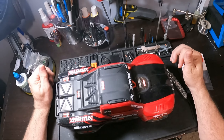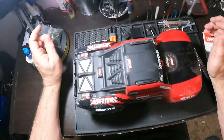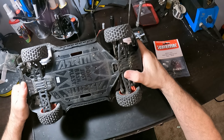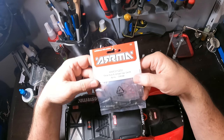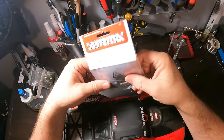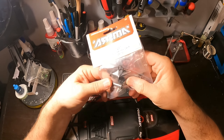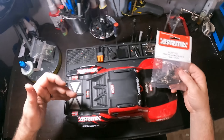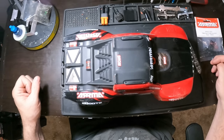On the Typhon I ended up putting HR front axles in it. I didn't do the rear. The rear is dog bones on all the trucks they sell. In the front of the trucks, they're all CVD, and the back is dog boned. So what we're going to be upgrading today is the metal axle and wheel hex set B, which is ARA311231, which gives you the hubs and the metal axles. In the rear, it just gives you the metal hubs. I appreciate you guys stopping by our channel, and hopefully we'll be making a lot more videos.